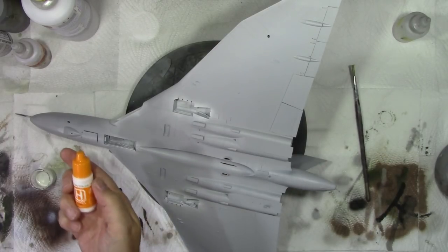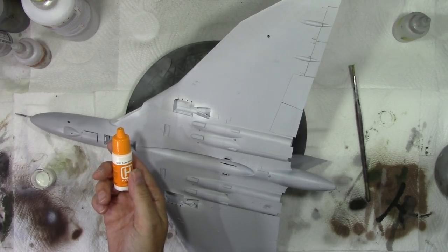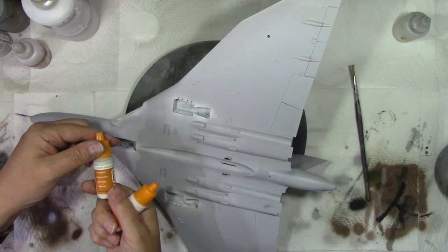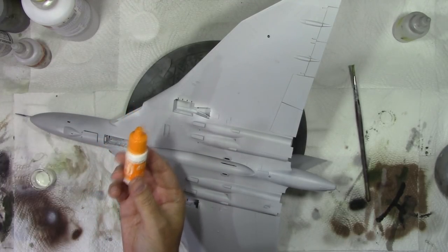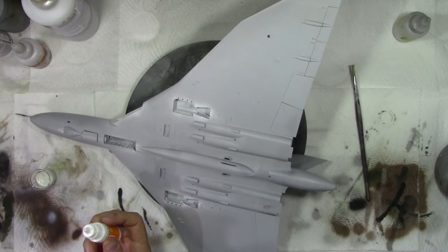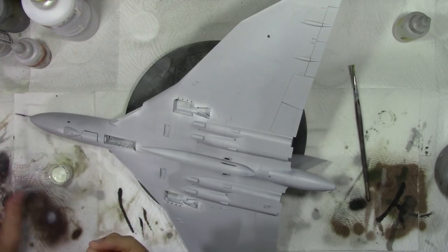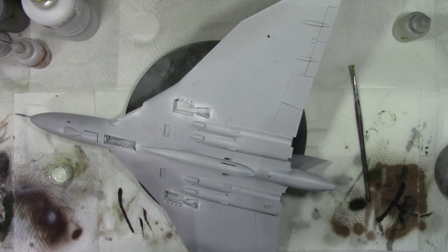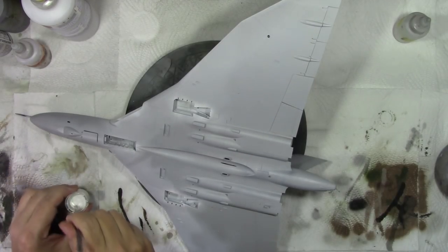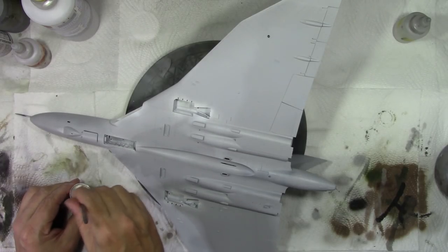But what we are going to do is come along with the pure white. They call this traffic white for the actual colour. So this is C101. The other one we were using for the insignia white is 049. This is a bright white. So in some ways you're sort of reverting back. So we're going to come in with probably a good mil of that in there. Again, so all we're doing is basically a 4-to-1 ratio down in this. And then we're going to mix the two together, which hopefully will give us what we're after.